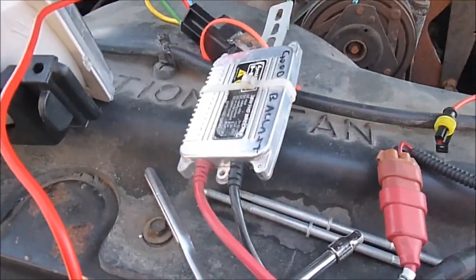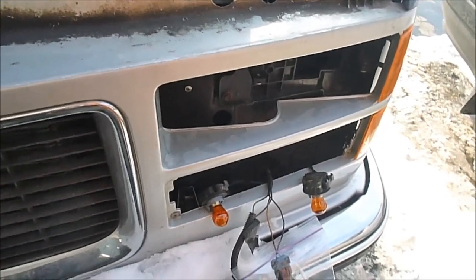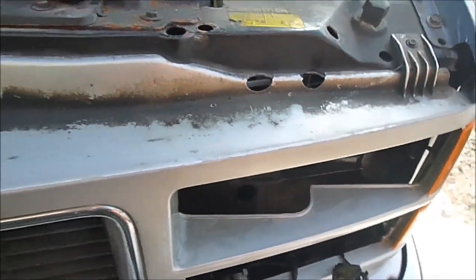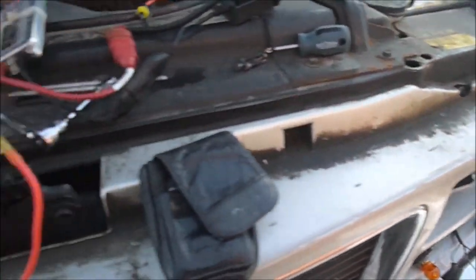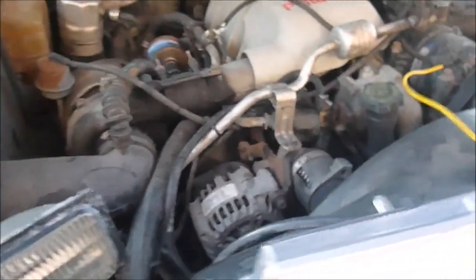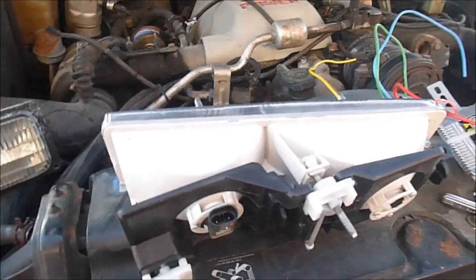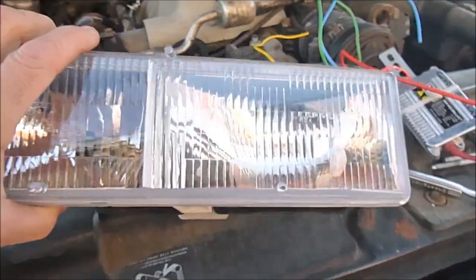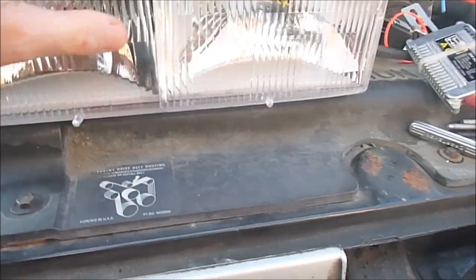Now you might see the HID ballast over here — that's because this vehicle was equipped with HIDs on the low beams, and those are absolutely terrible for oncoming traffic. When it was a little foggy outside, just the glare the lights would be throwing would be terrible back in my eyes. It has to do with the lighting standards we have: the European standards have a very sharp cutoff, which means less glare back in your eyes and for pedestrians and oncoming drivers, but it won't light up signs too well further down the road. Our lighting standards do allow a certain amount of glare to go up and out, perfectly fine with regular bulbs, but the HID bulbs just don't cut it.